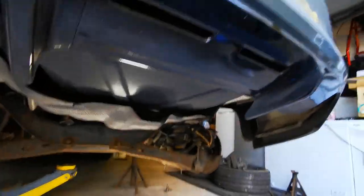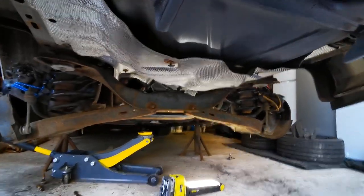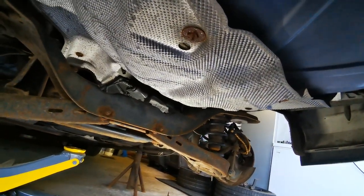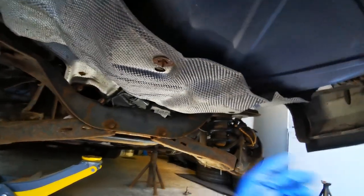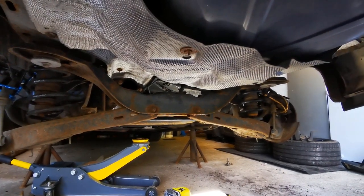Just a quick update — we're nearly ready now, we've just got four subframe bolts: one there, one under there, and then two on the other side. Then this whole thing should come free. I had to take off the back of the exhaust because the custom exhaust was very close to the middle and it looked like it was going to block one of the subframe bolts. So that was a mission of its own — had to cut the rubbers off because it's all custom and not really made to come apart. But at least it disconnected just over here — I thought maybe it was all one solid piece. Next thing you should be able to see is the dropping of the subframe.